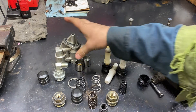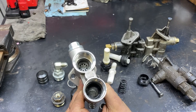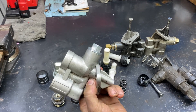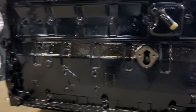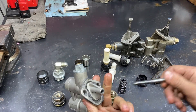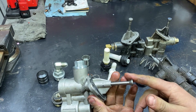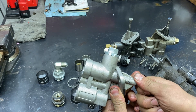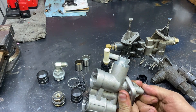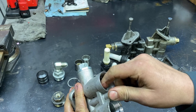To start off, I'm going to go over how the pump works so you have an idea of what you're looking at. This is the pump — it bolts to the block on the driver's side, kind of underneath the cylinder head. It has a plunger inside that rides on the camshaft, and the camshaft has a lobe specifically for this — only on the 12-valve camshafts. The 24-valve and newer camshafts do not have that lobe, so you need the 12-valve camshaft. There's a plunger inside with a one-way valve.